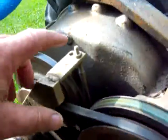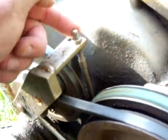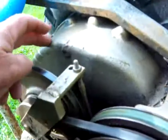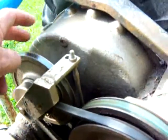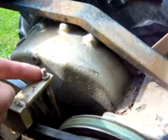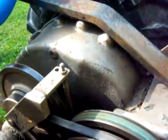I was correct that this rod here is the only adjustment. This rod, which turns into a cable, is the only adjustment. This front nut here is just to adjust your clutch, so forget about that. I'm also told there are no internal parts to be concerned about — it's all right here. You run this nut up all the way to leave slack.